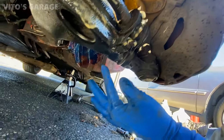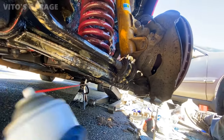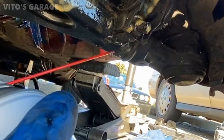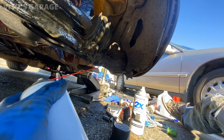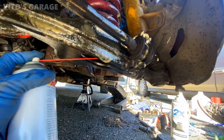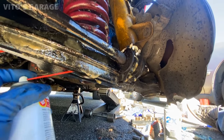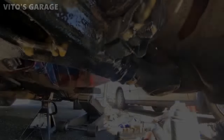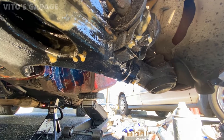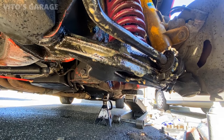It's a really good idea to also check these spots — I just sanded some surface rust and I'm about to paint and preserve it. These control arms on 190s, W124s, W210s, and W202s like to rust out in this spot because water just sits there. As you can see, this one has a hole in there, so some water can drain out, but I'm gonna grab fluid film and spray in there to preserve that spot. I sprayed a bunch of fluid film inside — as you can see it's dripping out of that hole. I also painted the bottom of this control arm in that one spot, waiting for it to dry, and then I'll coat it in fluid film and this side will be protected forever.